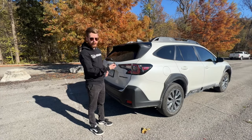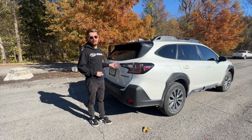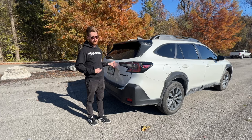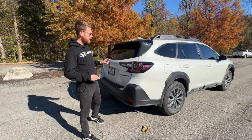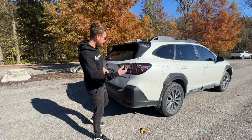To set this up, you're going to take your key fob, click and hold the lock button which is on the top, and then click and hold the pin code button. Hold it for a few seconds until you hear it start beeping — that beep comes from the front of the car. Then go ahead and click the unlock button, which is the star cluster logo on your Subaru key fob.